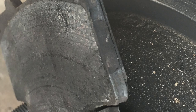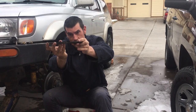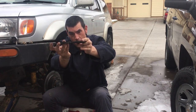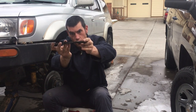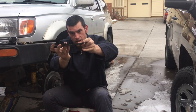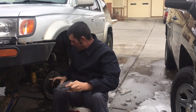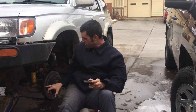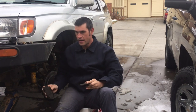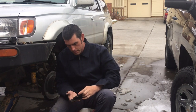This week — yesterday in fact — I heard a very awful scraping sound and found this: there is absolutely no meat on that brake pad. You can see this one still has about 3/16ths, while this one has absolutely nothing. It actually started grinding a little bit on my rotor.